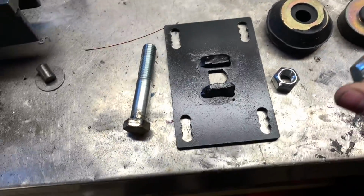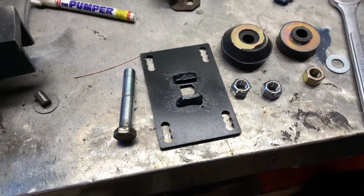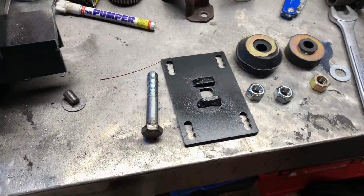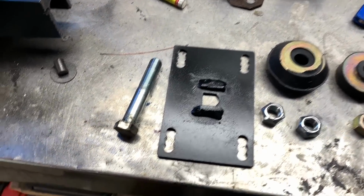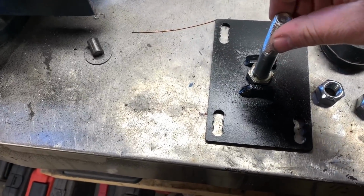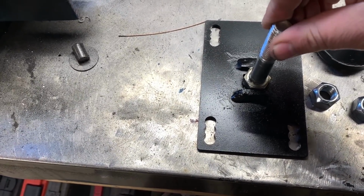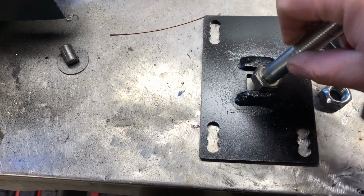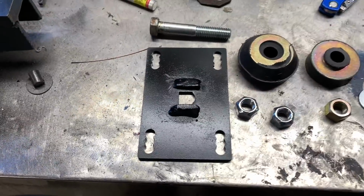And if you go this route, I highly recommend that you just hand tighten it only with a wrench. Don't try to put an impact on it, because you don't want to put too much stress on the bolt with an impact gun that might possibly bust that keystock out by chance or start rounding your bolt. It's best to just do it by hand.